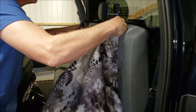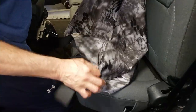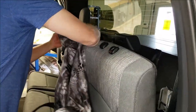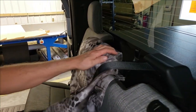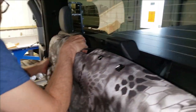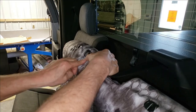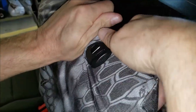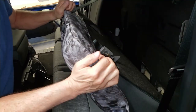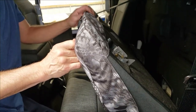It's just fastened to the back of the cab. Take the cover over — be careful as the Velcro sticks to the fuzzy carpet. Don't give it a yank; it is possible to tear this off. You'll notice there's a nice cutout for where the seat belt box fits. Tuck the seat cover under the plastic for the headrest, starting with the push button side — go across to the other side, not starting from the other side or you could potentially damage that button. Work the fabric around the top of the seat cover, along the back edge and up along the top.